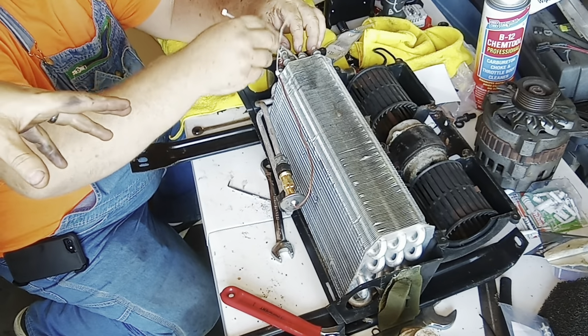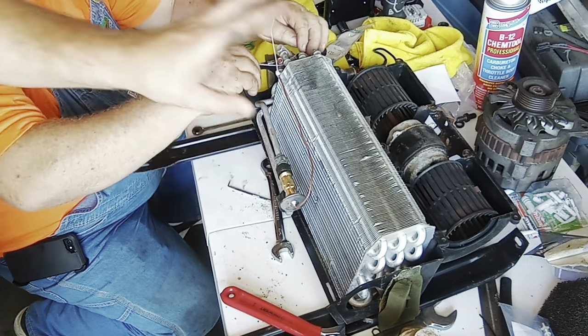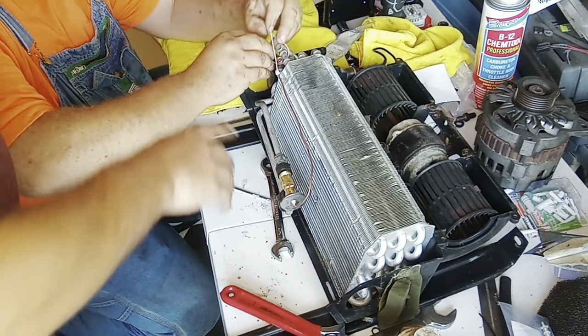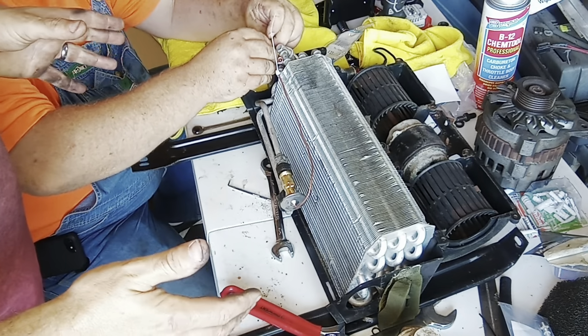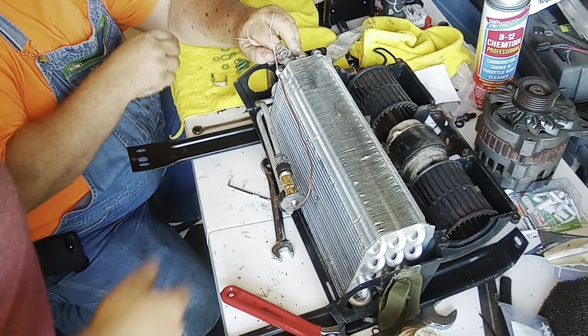And since we're already thinking some of this might leak because of the O-rings in this adapter, I'm just going to hook the lines up in the back and we'll probably leave it down off of the roof when we pull our first vacuum of the system. That way, if we have a leak, this is going to be the first place I check.